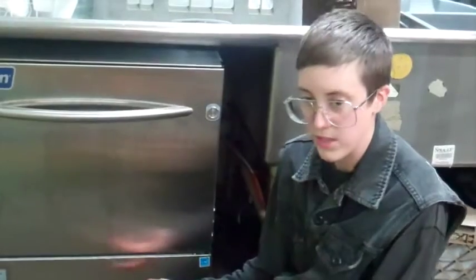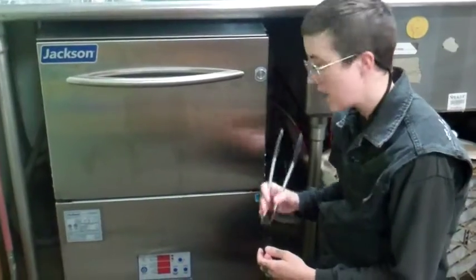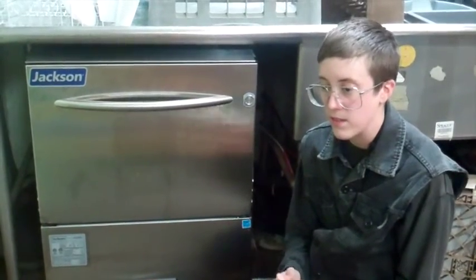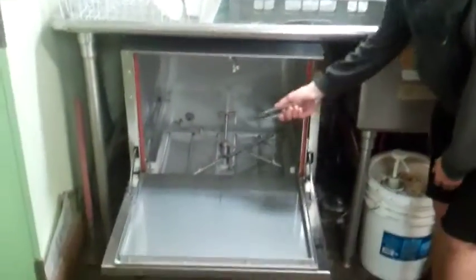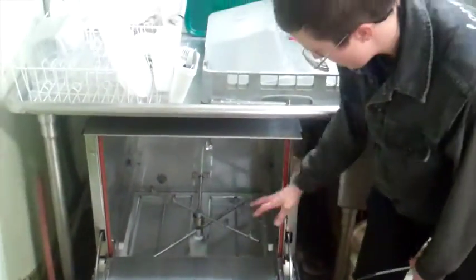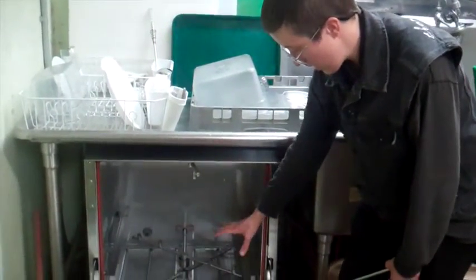This is the sound of the dishwasher draining — it only takes a second, just let it finish. If it's not draining, that means the drain pipe, which is very malleable, has been pinched and has a kink in it — that should be addressed. If it is draining, open the dishwasher. There should be almost no water left in there. In the well of the dishwasher there are metal grates that can be taken out. Mid-shift you don't necessarily need to take them out, but if there's food debris or spoons or whatever in there, you need to scoop that stuff out.